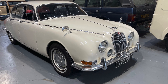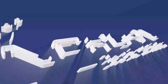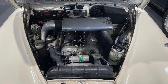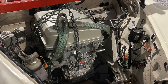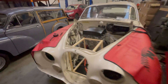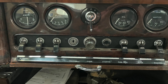Welcome to this video about this 1968 Jaguar S-Type EV conversion. The conversion uses all of the components from a 40kWh Leaf: the motor, inverter, PDM and also the battery pack. It is split between half the modules in the front and half the modules in the rear, and as usual we've tried to integrate it as much into the car as we possibly can.